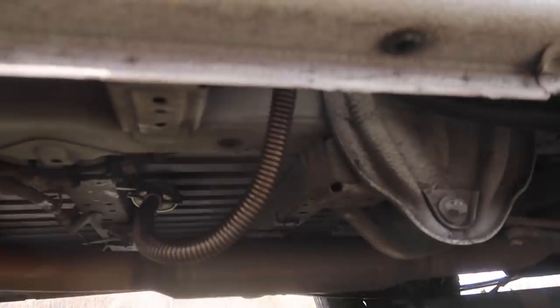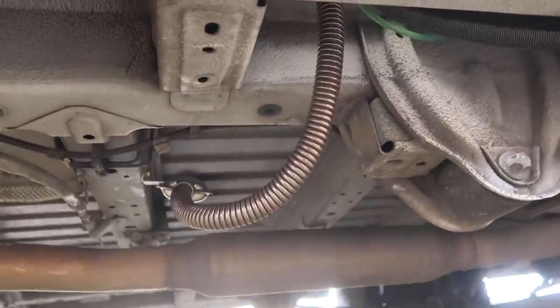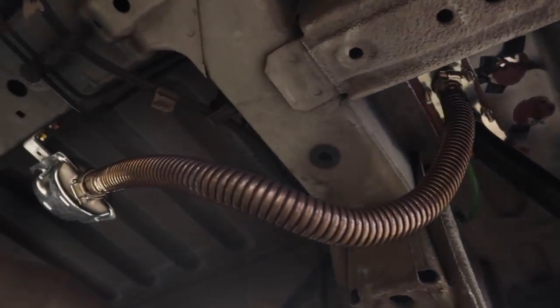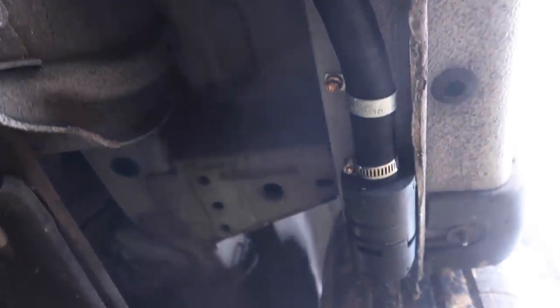Let's talk under-vehicle stuff. There didn't seem to be a really great place for me to put my muffler, so this is where it ended up. One thing I learned from watching videos is to make sure the muffler isn't facing forward in your van, because you don't want air and debris coming into it. Mine is kind of facing the side and it is in a protected area. With the black pipe that comes out from underneath my van with the little air filter on the back, I just made sure to keep it really far away from the exhaust — because you don't want to be pulling in air from your exhaust.